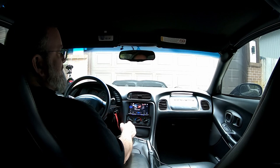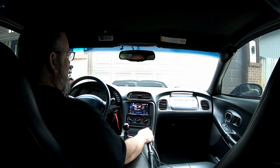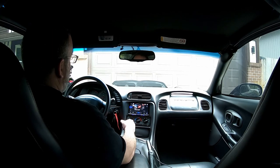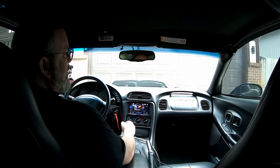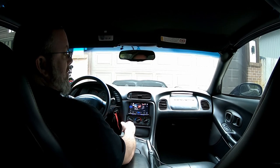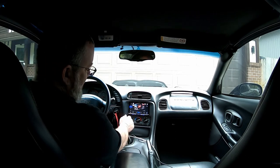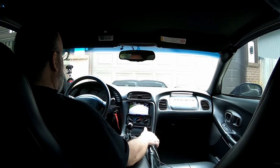Still in the break-in phases on this clutch, I was a little taken aback, so to speak, when I was reading Monster's instructions on the break-in procedure. And basically they say that they want 500 miles of stop-and-go traffic before you start going full throttle on the clutch. That's going to take me forever, and it's going to be stupid expensive with gas prices.